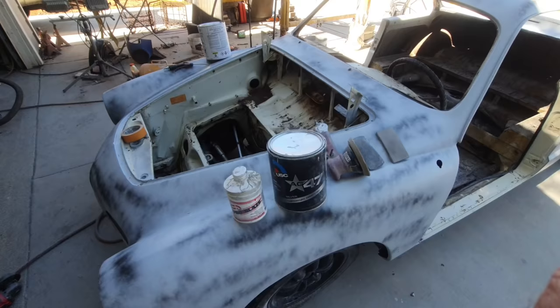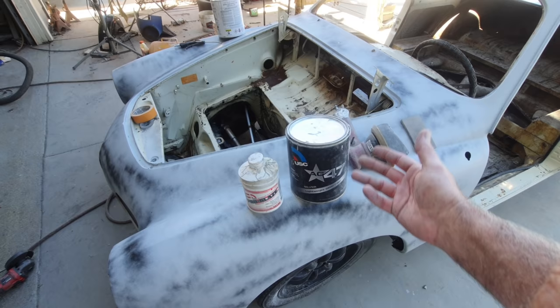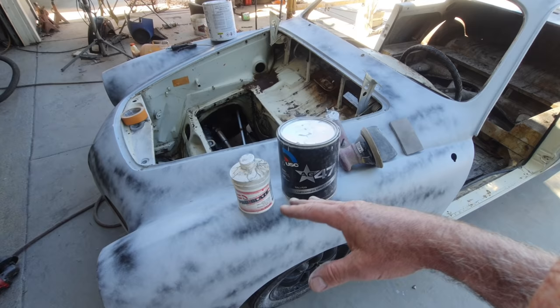It could be things like, I've seen guys get two tubes of hardener for a gallon of filler. They give you one hardener for this, and if you put in double the amount, you're probably going to have issues. It says on the label, it's one tube per one of these. So when guys are putting in double the amount, it's not designed to work that way. So it's going to have issues. It's like anything. You've got to just stick to it.